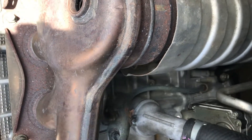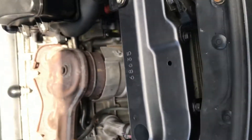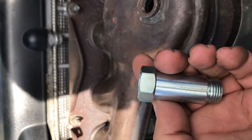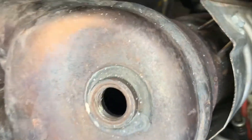If you have the money to fix it, replace the whole catalytic converter. If you don't, what you need to do is get down to the downstream O2 sensor and put one of these spacers between the O2 sensor and the muffler — that'll fix your problem. You also have to clean the catalytic converter because if you don't, it'll stay stopped up. Note: this is illegal in some states and is only a temporary fix.